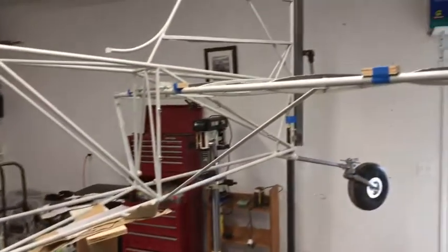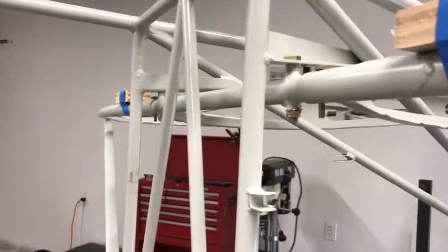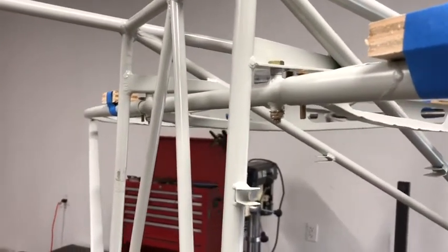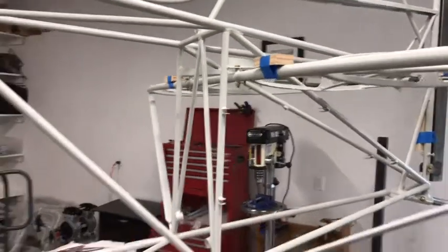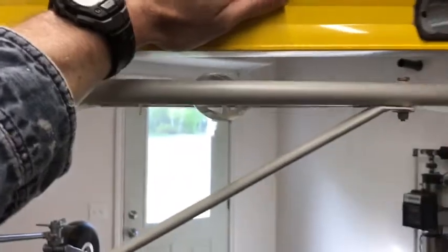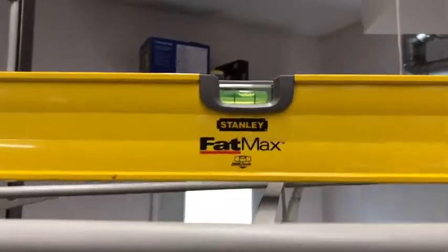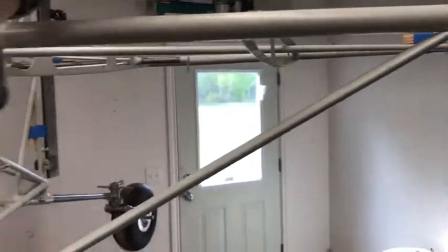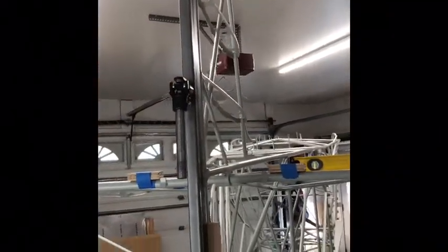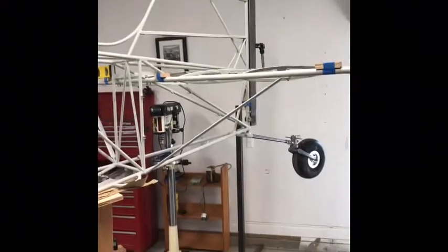Level. Now the horizontal stab is going to be down three degrees based on the size of the bushing I've got in there. As far as putting a level on all the different pieces here, I've got these little pieces of plywood taped in place so I have a straight line above all of the ribs and other obstructions. I wound up putting a handful of these plywood shims on both the vertical and horizontal stabilizers so that I had ways to measure in several different directions. To get the tail post perfectly vertical, I had to put a bit of plywood underneath one of the wheels, which tipped the tail just enough to get everything vertical so I could use it as a reference.